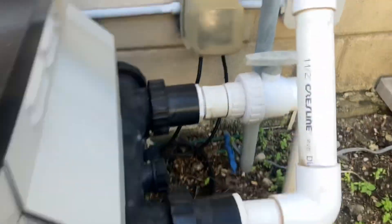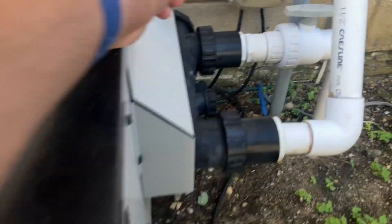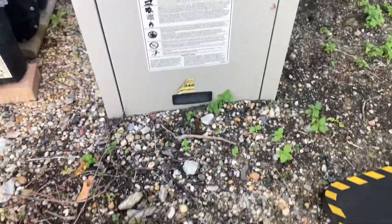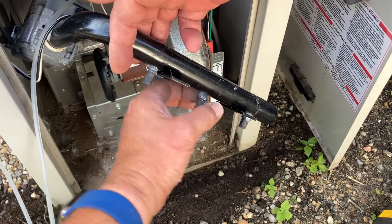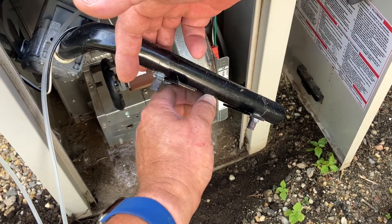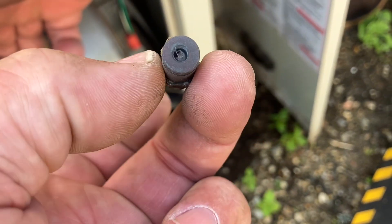Power's off. Let's excavate a little bit here and see if we can diagnose. We did a few tests off camera. I want to pull out this orifice right here — the answer for ignition failure is because of what's inside there: cobwebs.